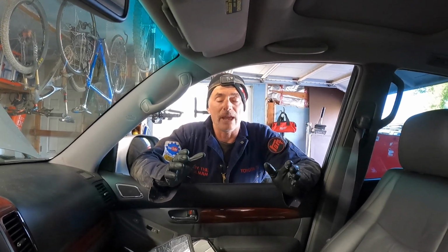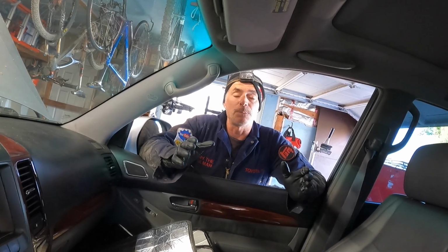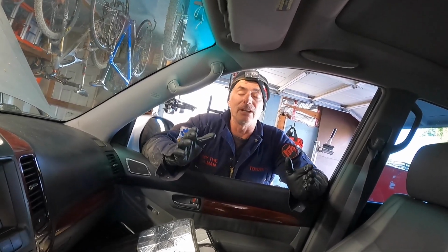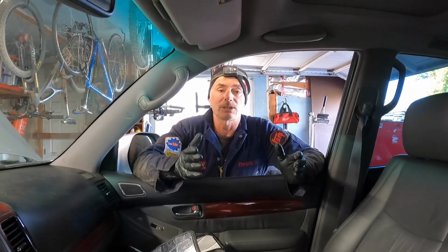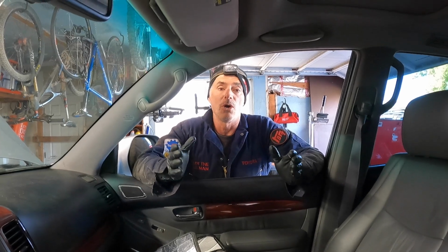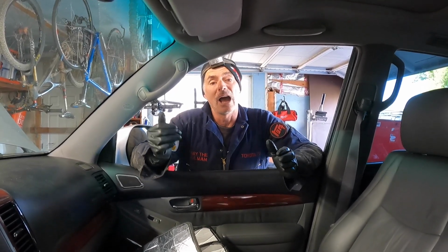All right, now that I've explained the fluid check procedure based off of what the factory service manual says, I'm gonna have Ton start the vehicle, and we have to get the transmission fluid up to that range of 97 to 115 degrees. We're gonna choose to get it to the middle of the spec. So 97 to 115 is an 18 degree range, and halfway through the range is 9 degrees, so 9 plus 97 is 106.